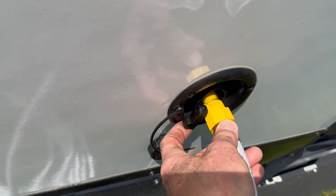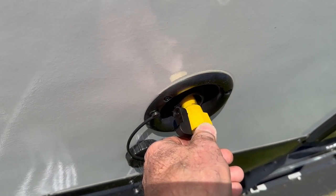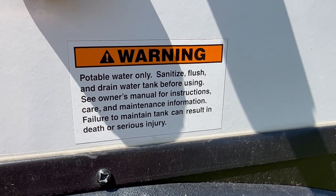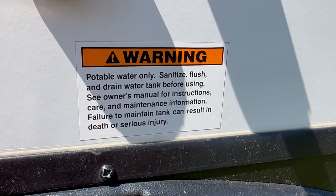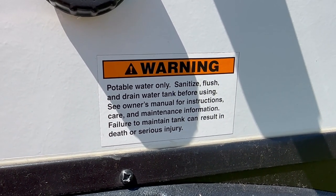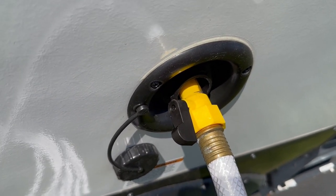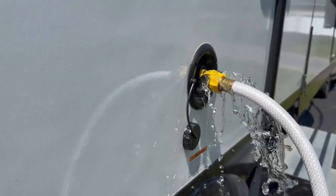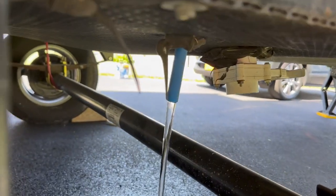The water's on at the house. Make sure you hold this before you turn it on so it doesn't come flying out at you — you're going to have a lot of air in the lines. Just keep filling it until your overflow starts pouring water onto the ground underneath the RV. Always make sure that you're using the right port when you're filling your water tanks. Some newer RVs also have black tank cleaning ports and you don't want to add your water there — you're going to have a big problem. It's usually marked with a tag. Just make sure you've got the right port. You're going to know that your tank is full when you see it pouring out the top too. I just threw my lever and we've also got our drain down below that shows us the tank is full.